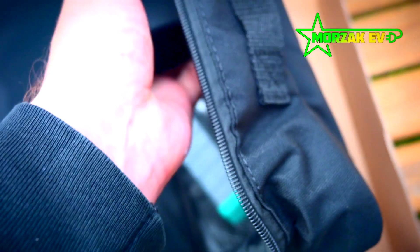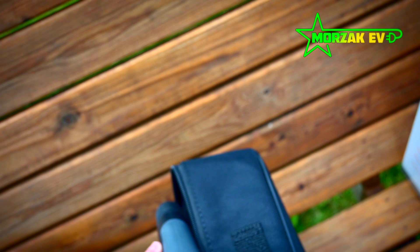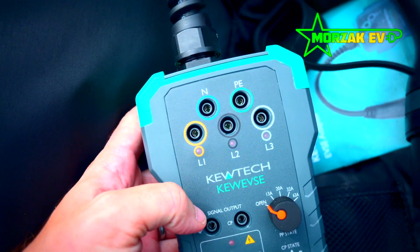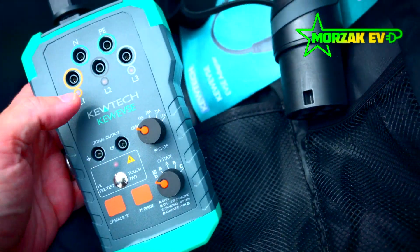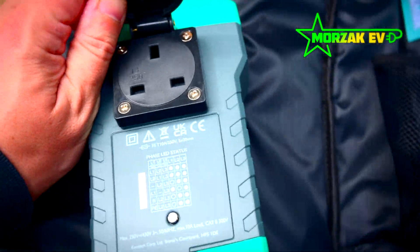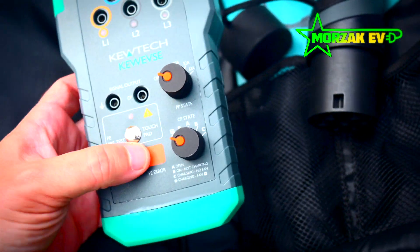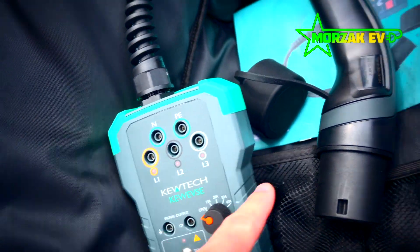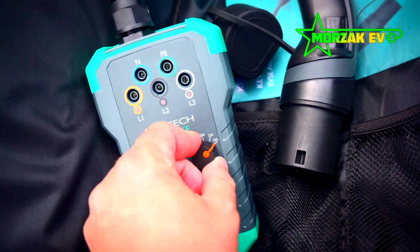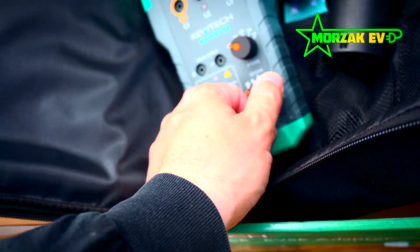On this end we've got the Type 2 plug, which should look familiar to anybody with an EV. And then on the business end — very, very similar. We use the three-pin plug kettle lead to go into the back of our tester to do single-phase circuits, and then we can do the three-phase testing on these ports here using the normal leads. We've got the different amp ratings for output in the signal, and then the different states for the vehicle.